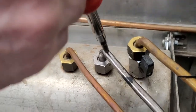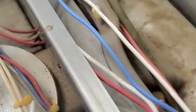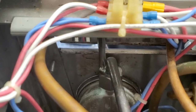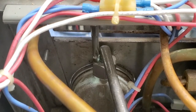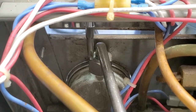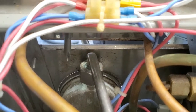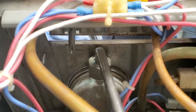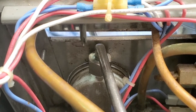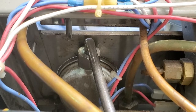Back on the steam boiler, this is our upper sight glass tube and that tube runs to our sight glass right here. It is very common for this upper sight tube to create a pinhole leak right where the connection is to the sight glass, usually after several years of use. That's due to condensation of the steam becoming water again — it sits on copper and eats at it. Steam is your purest form of water, and once it condensates and cools it starts attracting minerals, and copper is one of the metals it will absorb.